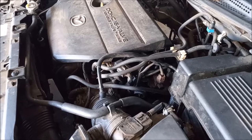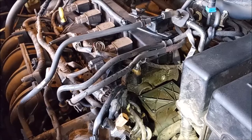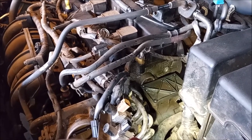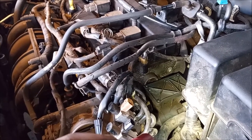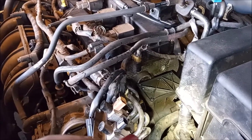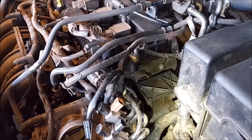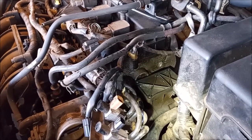We're going to dig into it and see where this coolant is coming from. I've already removed a lot of the parts that were in the way. Where I'm shining the light, you have a black plastic piece that the coolant hoses go into, and this black plastic housing is bolted against the cylinder head. Great idea — bolt a piece of plastic against a cylinder head with coolant going through it. Let's look at what happens to this coolant outlet.